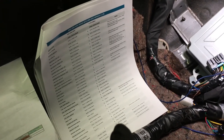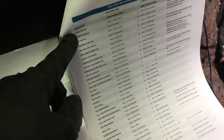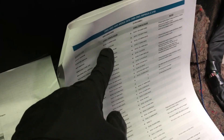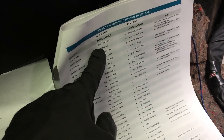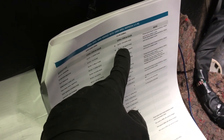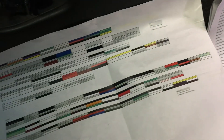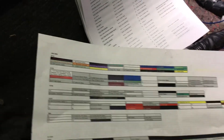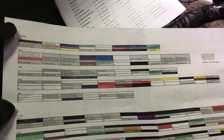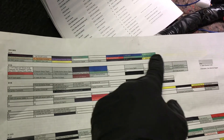I have this other guide - it's like a banshee guide. I already found some errors in it, but it tells you the description, like a speed sensor, and gives you the WRX ECU pinout. It's on B134 pin number one which corresponds to the GC8 B135 plug, pin 24, and so on and so forth. I actually created this myself - these are the WRX plugs that go into the ECU, and then each pin and the colors and what they correspond to.